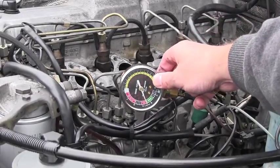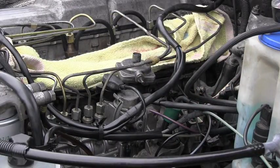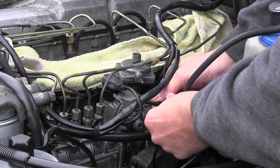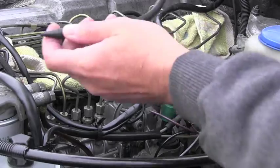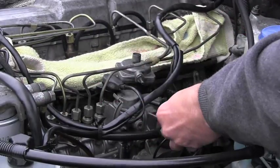The engine is off and you can see the vacuum is there. So coming through the ignition lock all the way to the shut-off valve, we have perfect vacuum. Our measurements confirmed what we said at the beginning — the shut-off valve is the bad part.